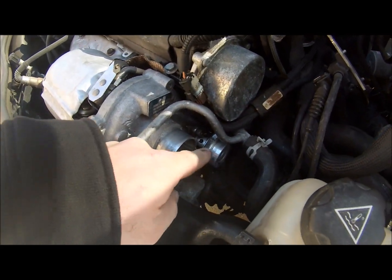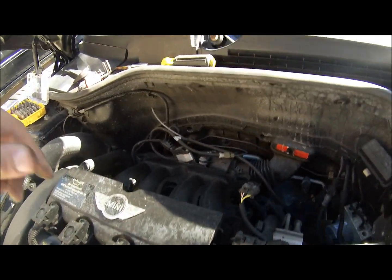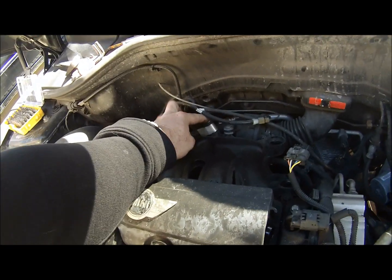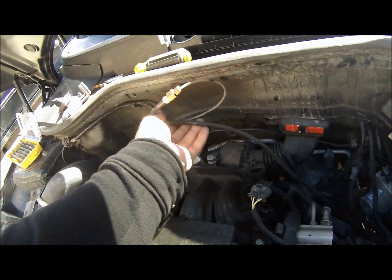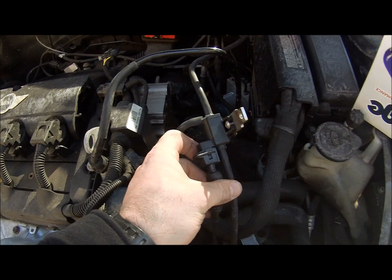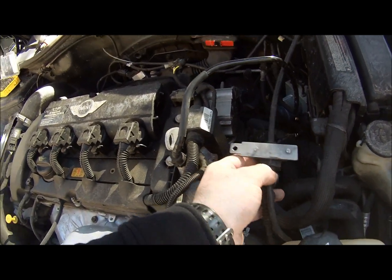What I have right now is the Forge Atmospheric Blow Off Valve — it is right here, right at the turbo inlet. Now if you have the aftermarket K&N intake, you know pretty much how to take it off — two clamps and everything. With the TurboSmart kit, one thing I don't like is the bolt they provide to replace the boost port adapter, because it needs to be longer to make up for that space. I'm going to continue using the one I have, just because I don't really feel like putting that really super coarse-threaded bolt in there. What is happening here with the Forge is it is vacuum powered — it goes to this solenoid here, which is the vacuum in. This one goes to the blow-off, this one also goes to the blow-off, but here is the connector from the computer. So it is still computer controlled. I am going to pull this out and put it side by side so you can see what the difference is between the Forge atmospheric blow-off valve and the TurboSmart dual port.